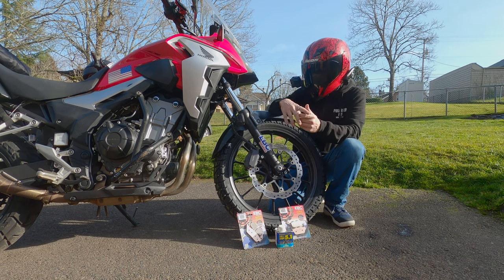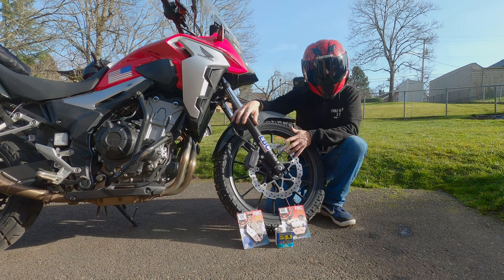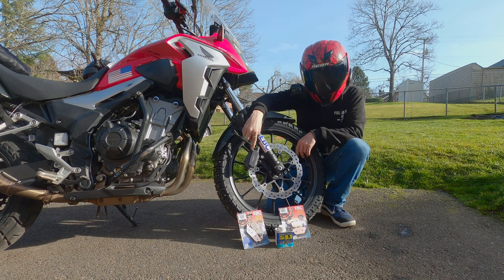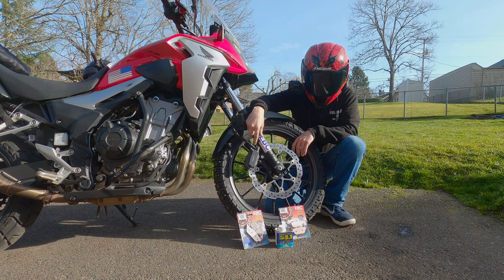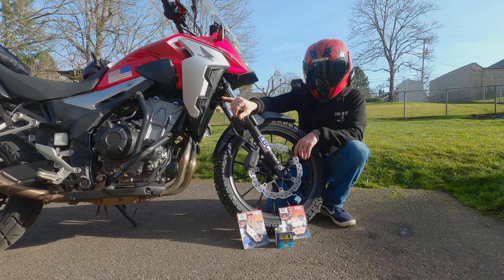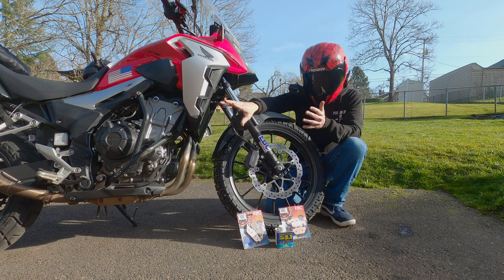upgrade for your brakes. So this is a Honda CB500X. As some of you guys know, I bought it brand new in early 2020. It's a 2019 model, and I've already replaced the front brake pads at 10,000 miles with EBC brake pads. I got about 15,000 miles out of these front ones, and I still have the factory original brake pads in the back. Overall, I have almost 26,000 miles on this bike, and so I got about that out of the rear